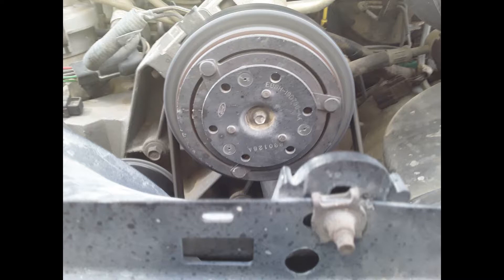I'm fairly certain that my problem is in my AC compressor. However, I put the video on here even though it didn't work for me — I thought it was still worth showing people. Because had my AC clicked on, I would have fixed that unit for about $40, and that's pretty cheap. Now if I wanted to change the compressor out, it's about $250 for a new one. But with AC systems, you need to vacuum them out and pretty much change the whole system — you can't just change one component. So I'm looking at $600 or $700 if I do it myself, $1000 if I pay someone else. In my case, I probably won't go any further with fixing it. But if you have an old vehicle, it's worth trying for $40 to see if you can retrofit it and fix your AC unit.